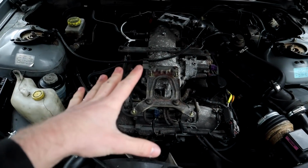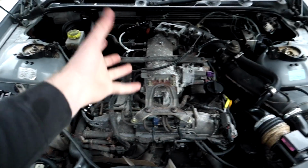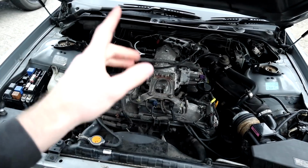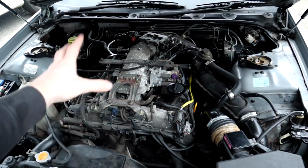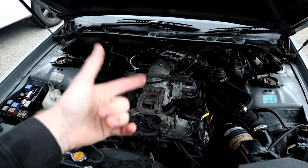Now if that doesn't work, that stuff stays in the engine, and all those fumes that I've created from combustion, they will go into the bottom of the engine and mix with the oil, and that mixture makes the oil thick and sludgy, and it creates a pressure inside the engine and does create oil leaks. So I've not got any oil leaks, luckily, but I have thick oil.